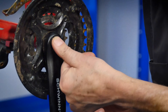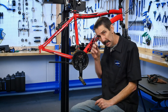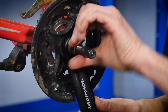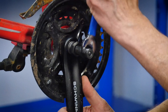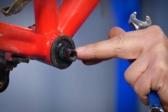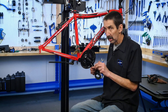...with hundreds and hundreds of pounds of force as they ride the bike. You're keeping it on there through the presence of the torque on that bolt. That's what you do, mechanic. So we're going to go ahead and pull this off to see what the good fit is and talk a little bit more about the spindle. These are a square spindle, but they actually have a little bit of a taper. The extractor comes off, and there we are. You can actually see some of the footprint — the aluminum arm rubs on the spindle and leaves a little mark where it used to be. We don't want this to go all the way to the end. Good fit on this side; a new arm is needed on the other side.